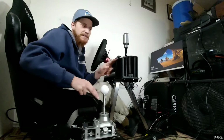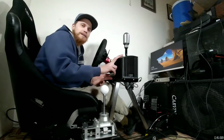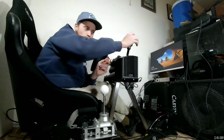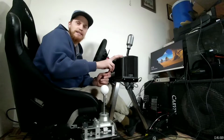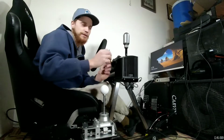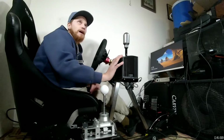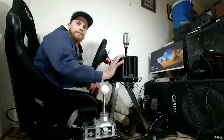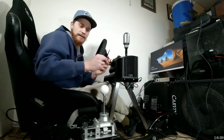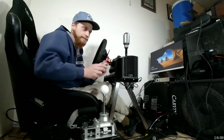So now, in terms of the technology inside of these units, this one's a lot more simple, but this one is more robust in a lot of ways. This is using Hall sensors, so it's just like magnets floating around in there. When you go into 3rd, the way that this detects it is a magnet will either be in a certain place or it'll be out of a certain place. Depending on the combination of where the magnets are, that's how it's able to tell what gear you're in. So that's a technology that will be lifelong. So the circuit board or the shifting rod itself would break before those magnets ever wear out. It's just magnets last a lot longer than anything that makes physical contact with each other.